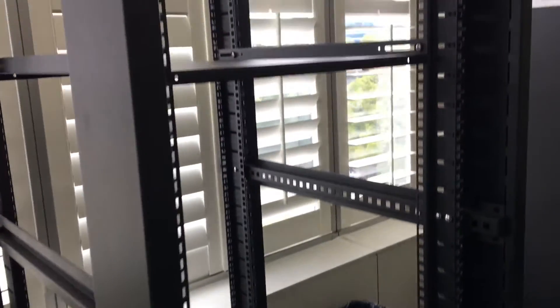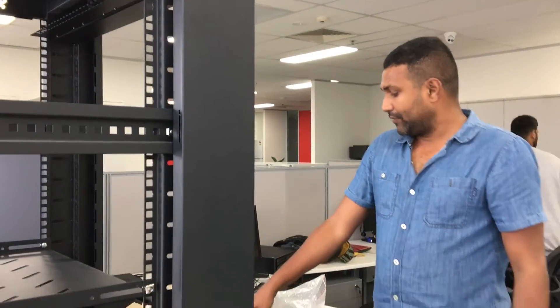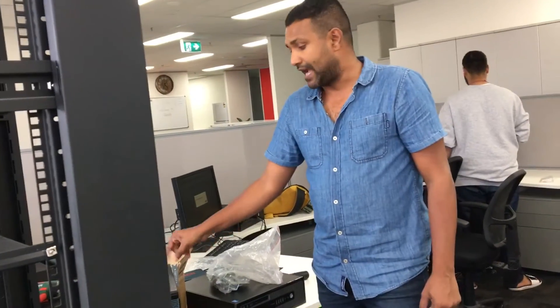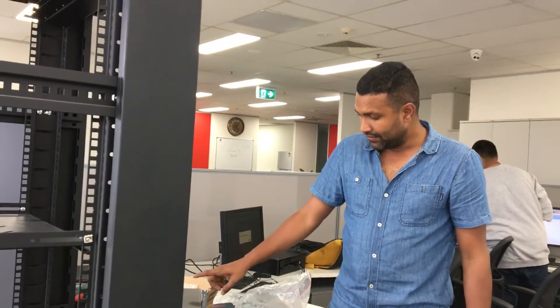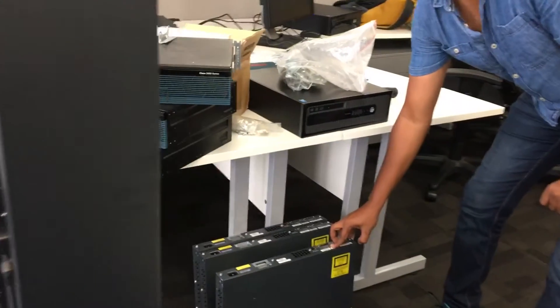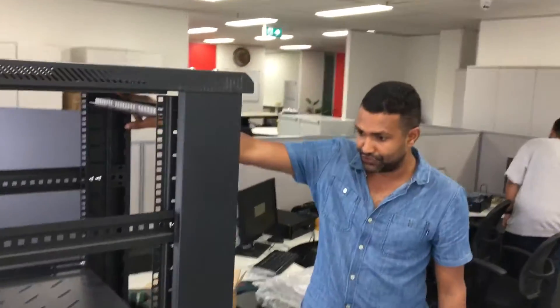This is our main server. The main server basically occupies the maximum space — I think it occupies up to 5RUs. So we are left with only 32. Now in those 32 rack units, we have to plan how many switches will go in, how many routers will go in. Right now I was just fixing the attaching panel for the router, and one router basically takes 2 rack units. So 3 of these routers will take 6 rack units. One switch takes 1 rack unit each. So we are left with 6 plus 3, so 9 rack units. I think we should be able to do well with 32 rack units.